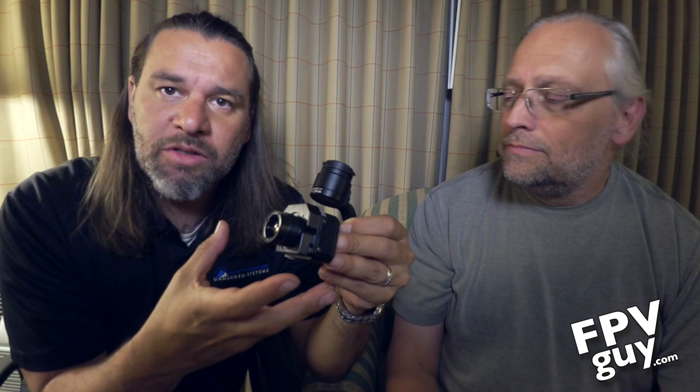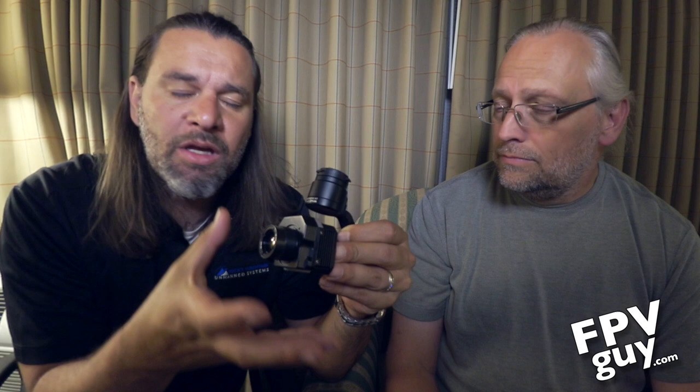I also wanted to add that in recent calls after selling the XT, new firmware updates have come out from DJI. Just so people know: the normal updates you typically do with the SD card into the X3 or X5 camera — we've got to remember that the XT does not accept those firmware updates. It can't read them. To do a firmware update on the Inspire, take the X3 or X5 camera, put that on the Inspire, and then you can do an update. The XT itself does have a dedicated page from DJI that also has its own firmware updates.